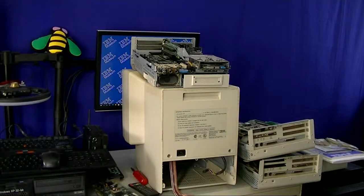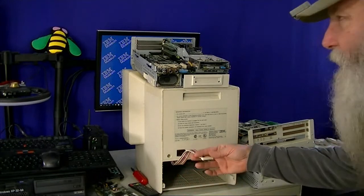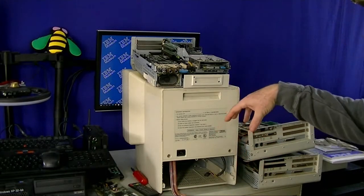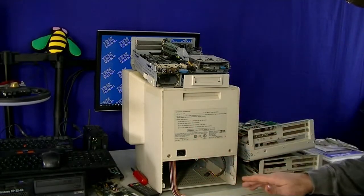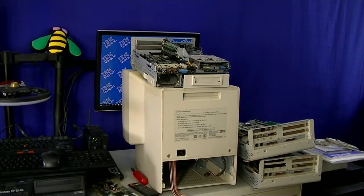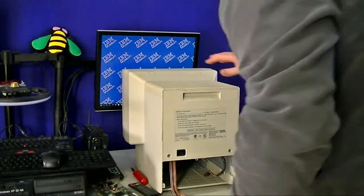But all the stack that I have behind me here is that I've got some trays pulled out of these units. The EduQuest is a lot neater than the Model 25. With the Model 25, as explained in that other video, you put the CRT face down on a towel on your bench, and you drop the tray, it rotates down. And it's not an easy way to troubleshoot it or to view that screen while working on everything else to see if the unit comes up. What I want to do here is take the main display assembly and set that off to the side.